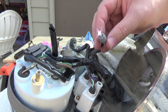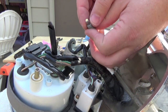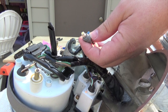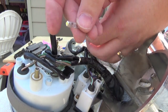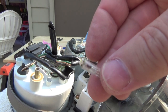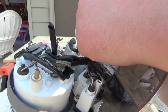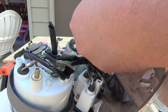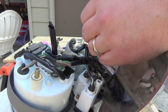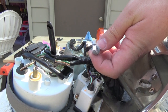Shove that LED in — you can see it fits the same base. Turn the ignition on to test it and, as you can see, it works — it's in there right. However, if it's in there backwards and I go to turn the ignition on, nothing. So you can see they're polarized. Look at the inside — there's a resistor and a diode already in the bulb assembly. The main thing is you need to test each bulb you put in because of the polarity. I swapped it around and now it comes on just fine.